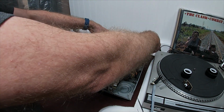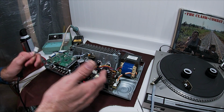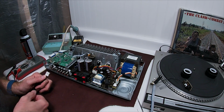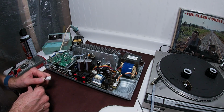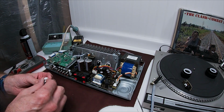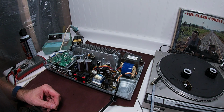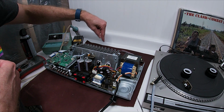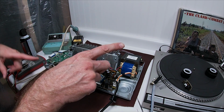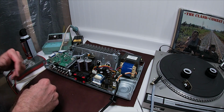And so before I went any further with troubleshooting, first off, the symptom was I was plugging it in, and normally when you plug in one of these amps, they pop, there's a relay that pops off. So before I troubleshot anymore, I was going to plug all of this in to see if I could get the magic pop. Beautiful. Comes right up, and the display is saying input number 1. All right, time to take everything else back off and then start putting it back together.